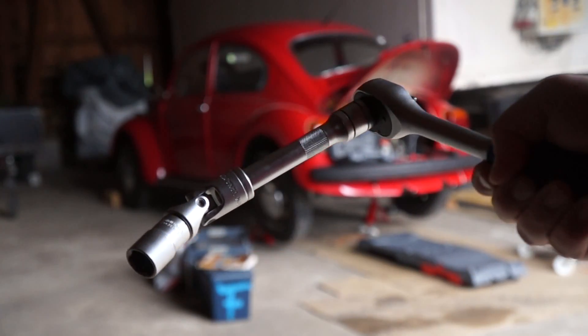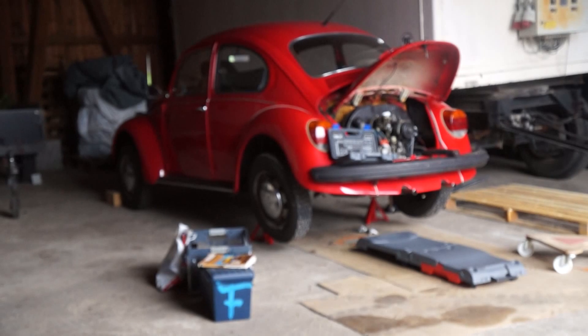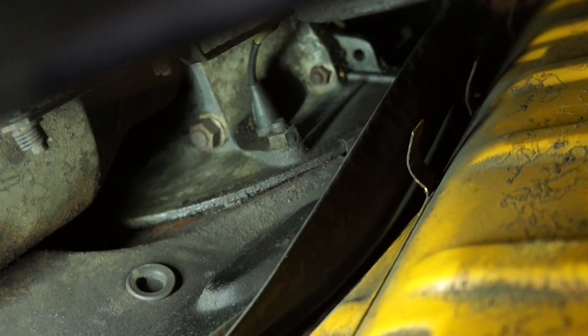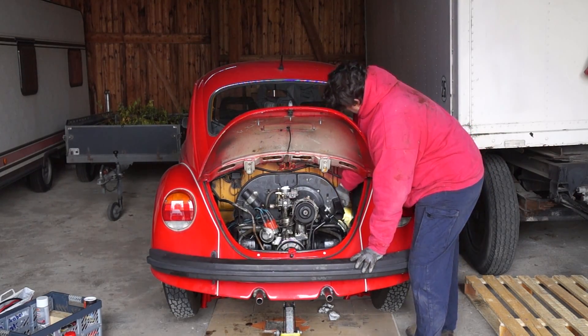Here is a trick for the hard-to-reach top left screw. You need to have your ratchet set up like this — lay straight under the vehicle and grab around the gearbox. This is the way you access the top left screw. It is kind of hard to get to but you can get there with a spanner. All the bolts are 17mm I think.